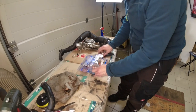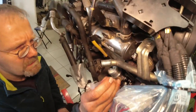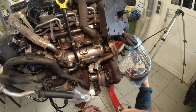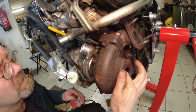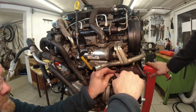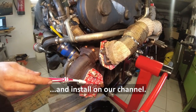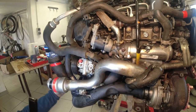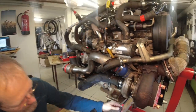The next step — fresh black oil which goes into the turbocharger — we put it right in here. Rotate the turbocharger a couple of times. Then the turbocharger is closed up. This is marked, this is marked, so these can actually stay on. These are a nightmare to get out, and down here is the side.